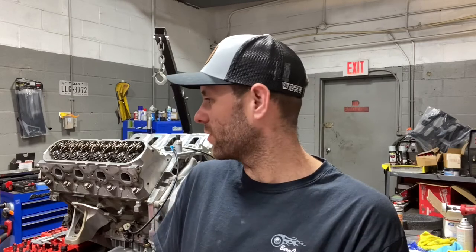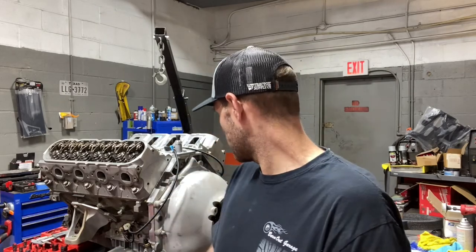It is very important to measure air gap. If you don't get this right, you don't have enough room for the slave to fully release the clutch, causing hard shifts and strain on your synchros. A lot of Corvettes have shifting problems at high RPM and often that's because the air gap is incorrect on an aftermarket clutch. For OEM stock parts there's nothing in the service manual about setting air gap — just put the parts in and you're fine. I appreciate you watching — hit that subscribe button, give me a thumbs up if this helped, and we'll see you in the next one.